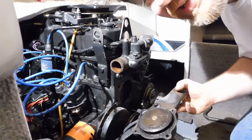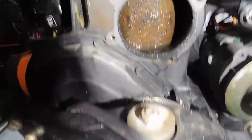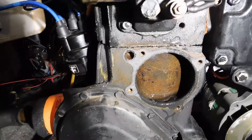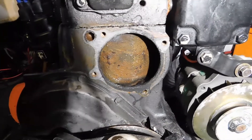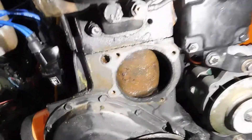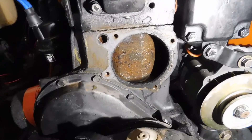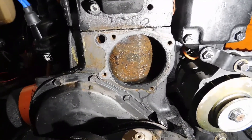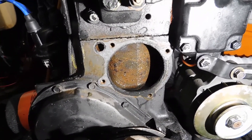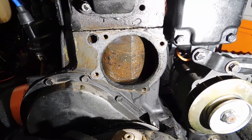Unfortunately this fell out off camera — I had to use a rubber mallet to get it off. This is definitely the water pump from 1989. If you're wondering what it looks like without the pump, there is cylinder number one. You are going to get water out when you pull it. Now the next step is to clean that gasket off. I'm going to use heat-resistant Permatex silicone to put mine back on — yes, I know it's probably not considered right, but we all know the history of this engine, so I'm just going to slap it together with that.